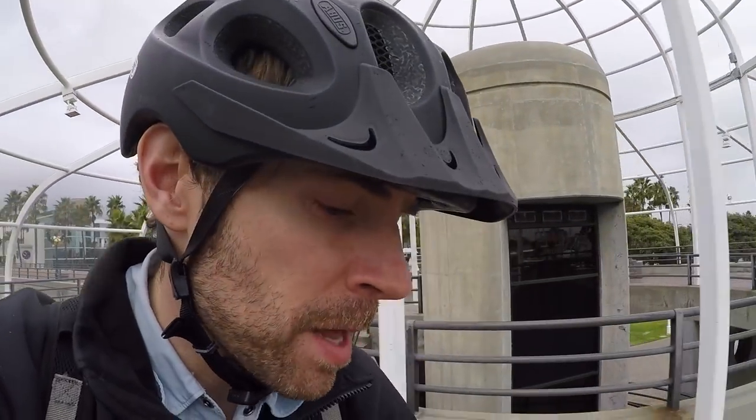This bike is in a higher gear, so it's really quiet. Most of the time that noise comes from spinning at a higher RPM. These Performance Line motors can support up to 120 RPM, compared to the Active Line at like 100, and the Active Line Plus at 105. So for me, being able to spin quickly is more like a road bike. It's sporty, and the motor won't drop out on you if, let's say, you're heading towards a hill and you're downshifting because you know you're going to climb.